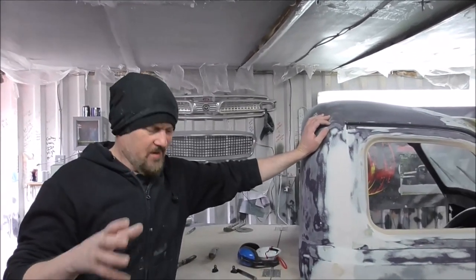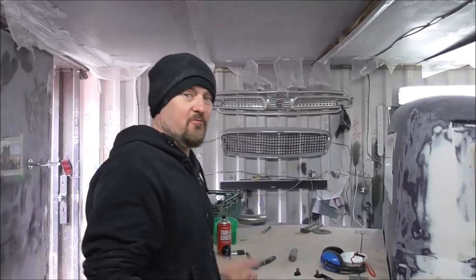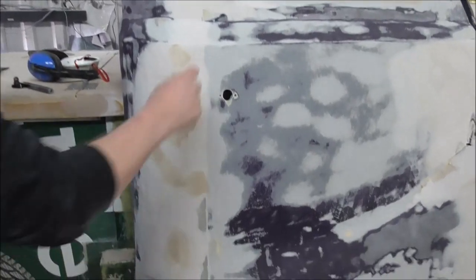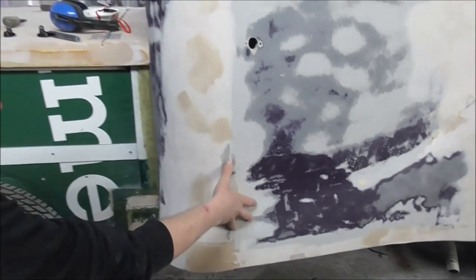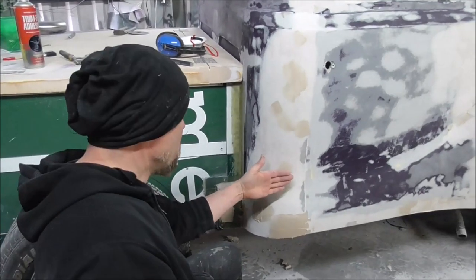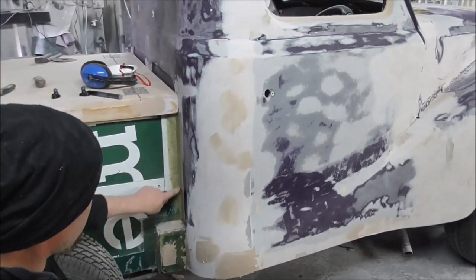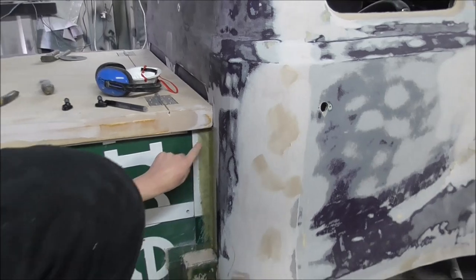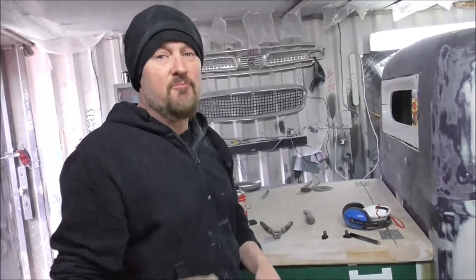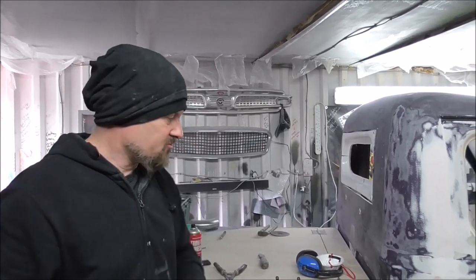I've done quite a lot — probably not filmed all that I should. At the back here, I've glassed all the way down and bought this whole panel out and reshaped it — from probably 10mm down to nothing around there. I've also got some fiberglass in here to start bonding the body to the bed so that can be made good. We're using fiberglass mat and resin there because there's less chance of it cracking with any movement — it really sticks and it's really strong.